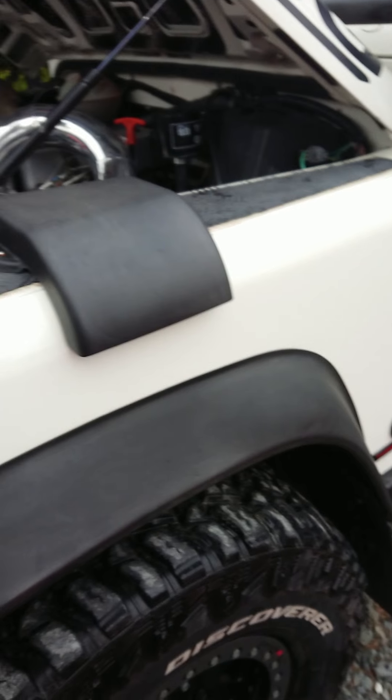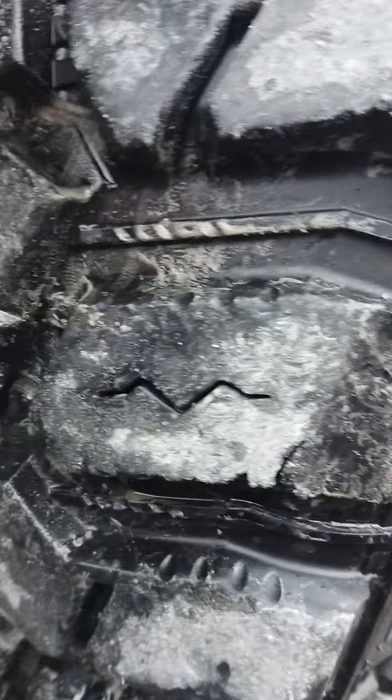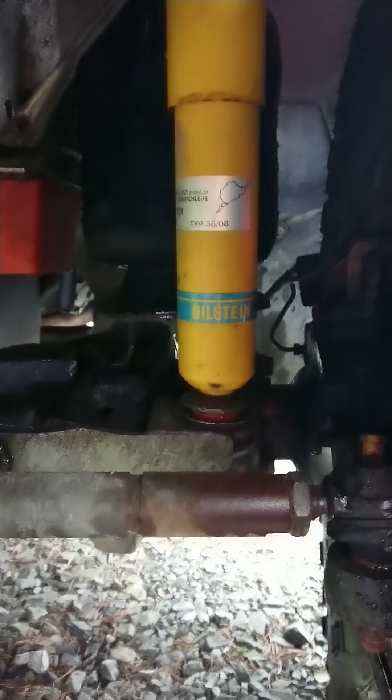This particular Land Rover has air suspension — it's actually sitting on DAF bus bags. That saves me having to work out what spring rates I need for the Cummins. Also in here you can see the sump is spun backwards. You need a reverse sump pickup pipe to spin the standard lorry sump backwards to fit the Cummins into the Land Rover. You can see it's still quite tight to the pumpkin of the Land Rover diff.